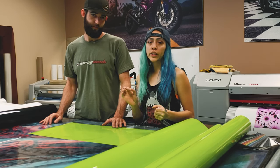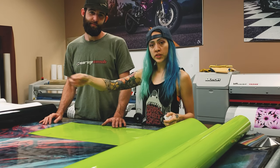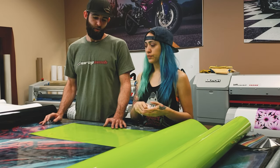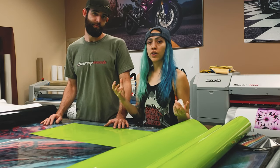Right, so when we're pulling knifeless tape, we usually will remove the cover film and then pull the tape. When we go around the edges or do any trimming, by that time we like to have the cover film off. Normally we just try to get the surface of the film down. You try to get a majority of the surface down.